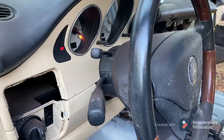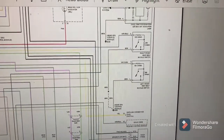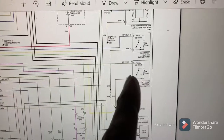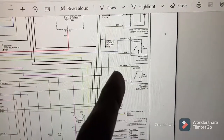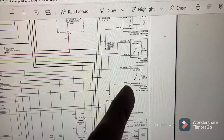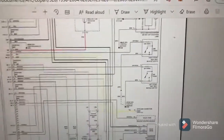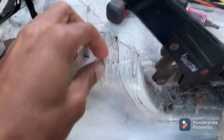Might have to do some more digging, but I guess we're ready for the rust seal. Oh — I forgot that the seat belt buckle switches need a 100 or 300 ohm resistor, so I'm gonna put 100 ohm resistors in there so it thinks the seat belt is buckled. That needs to be on the gray and green wire for the driver side and brown, or the gray and blue wire and brown for the passenger side. Let me go find those.